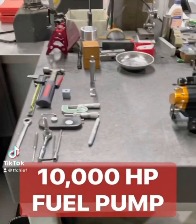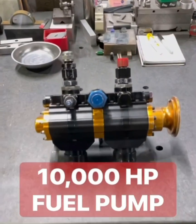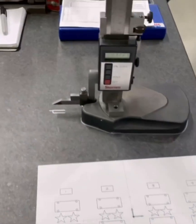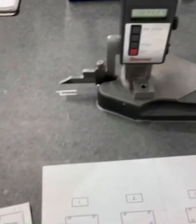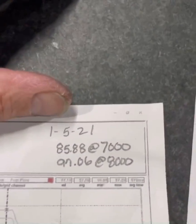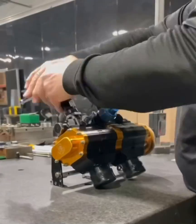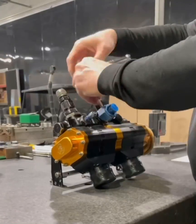Let's rebuild a 10,000 horsepower fuel pump. A good friend of mine called and asked if I would rebuild this pump for another team. Being as we're not racing at the moment, I said hell yeah. Before I got a hold of this thing, this pump was tested, and it tested at 97 gallons at about 8,000 RPM, which is about 4,000 pump speed.